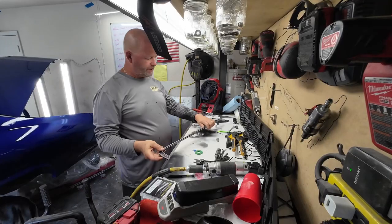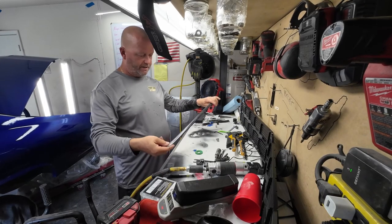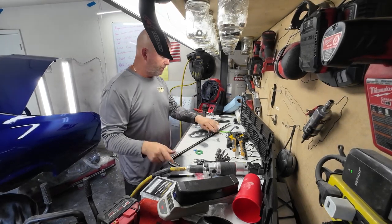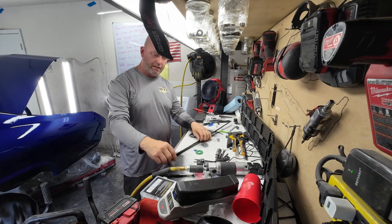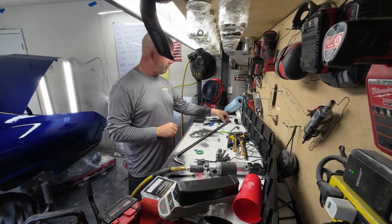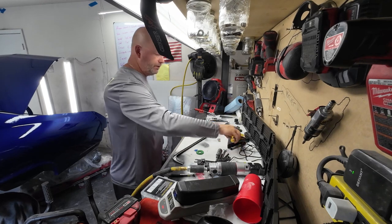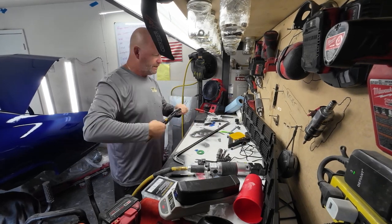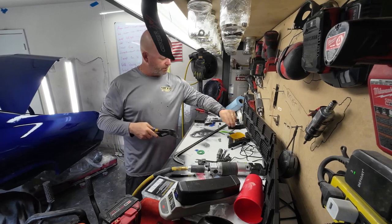Because I couldn't get these things to hang a certain way, I missed some spots. On other parts I can grab a little clamp, but in here I need some kind of spreader. So what I came up with is a neat little solution you can do at home. You take a little piece of wire — about six inches long — and put a little bend on the end so you can grab the lip.